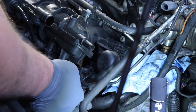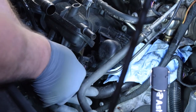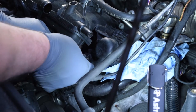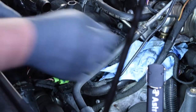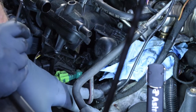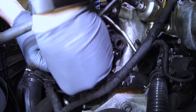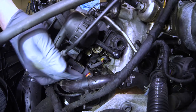Here I'm removing one of the many vacuum hose connections and I'm using a spring hook to just barely get down along that hose — not puncture it at all, but make sure it comes off easily. Underneath where those vacuum hoses connect there's a small connector going into the intake manifold, so here I'm getting that undone.